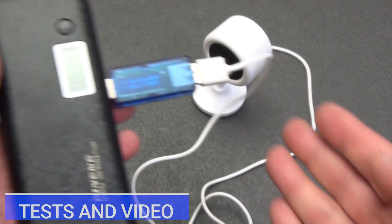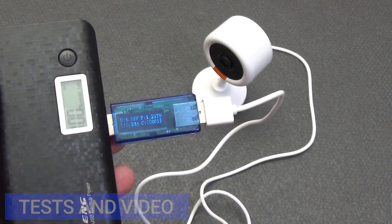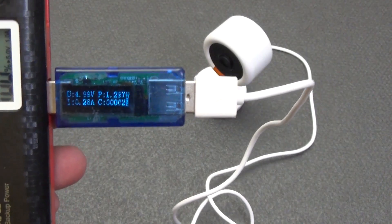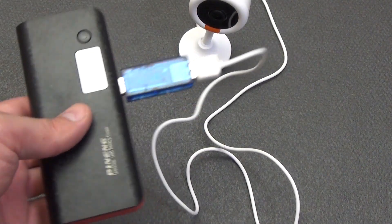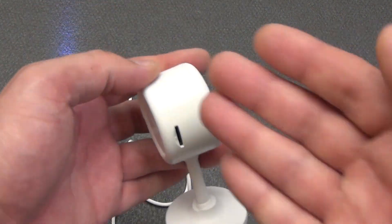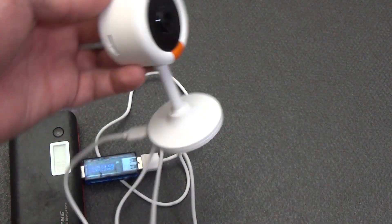Now for tests. Since I bought the camera for home use, let's check how many amperes it consumes. In standard operating mode it draws 0.3 amperes, and in night mode 0.35 amperes. As you can see, even connecting it to a simple power bank will provide a long battery life. Even when there is no Wi-Fi connection, the camera records everything to the installed microSD memory card.